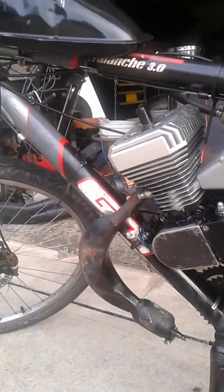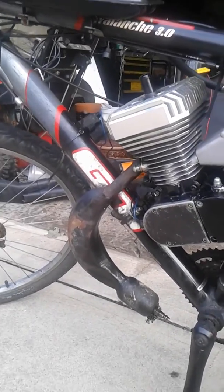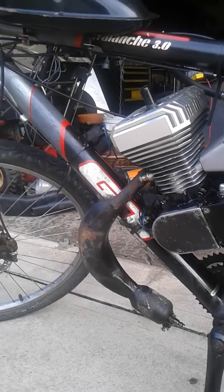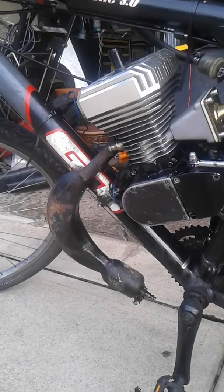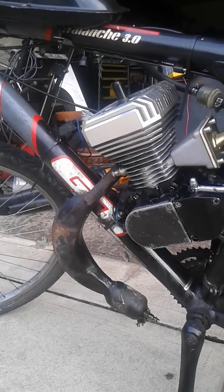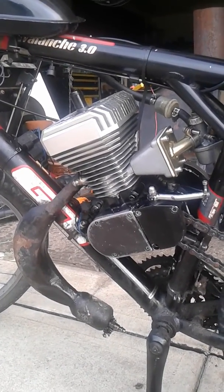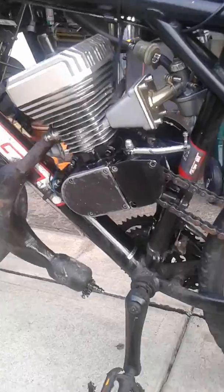This bike I'm still trying to figure out — I just ordered some crank seals. I've been wanting to sell this top end; it's a 47mm iron sleeve cylinder I won in a raffle a while back and haven't used it much. I was running the OZ carb and still couldn't get the jetting right, so I switched over to the G2. It has a little more torque, but I think it has an air leak somewhere — I've been trying for months to get this thing running right.